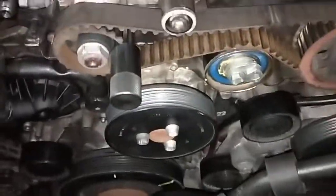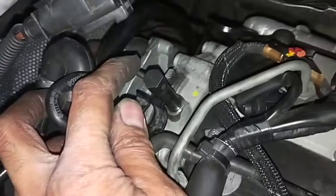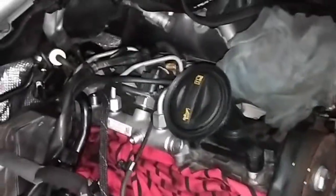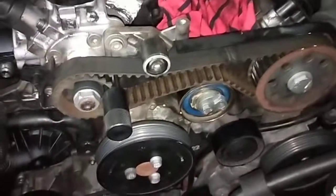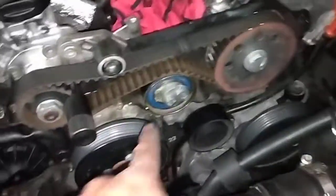I'm back at the top now. You see that one there as well — that's for the camshaft. So make sure it's lined up as well. Now I can remove the actual pump, and the cam belt, and the tensioner, and do the job.